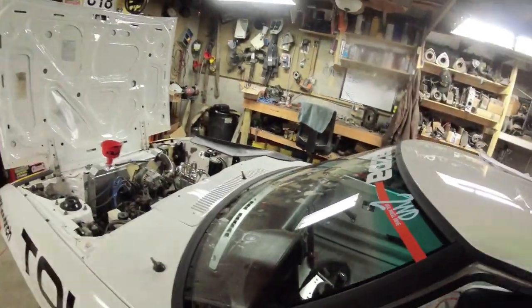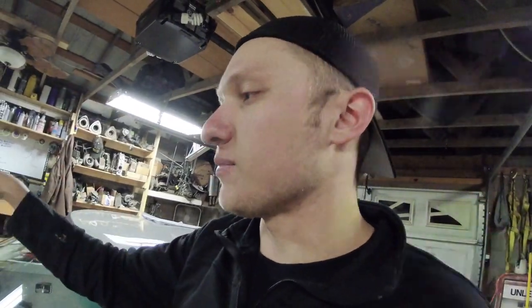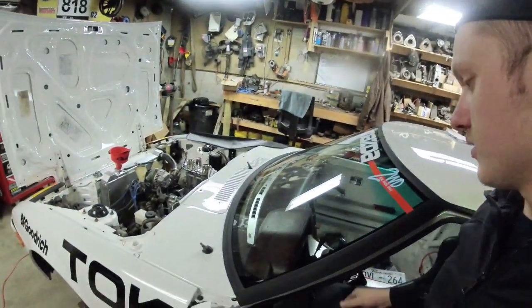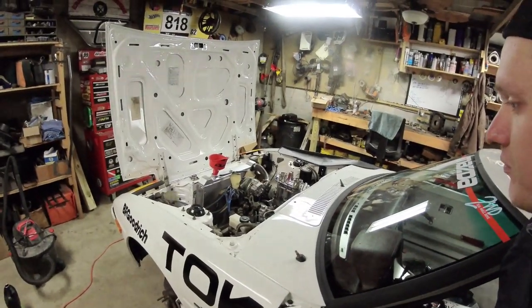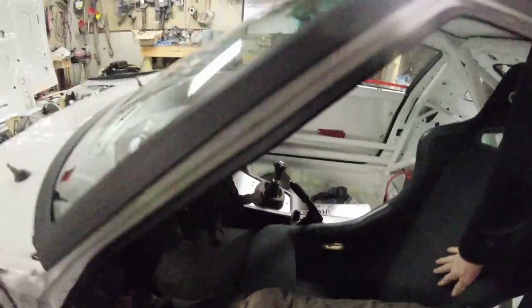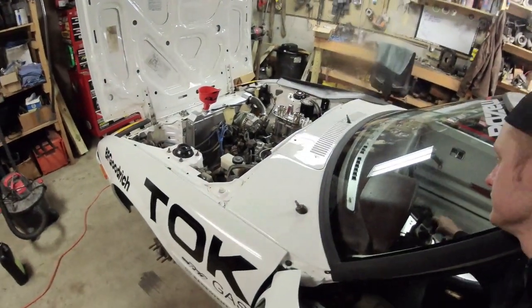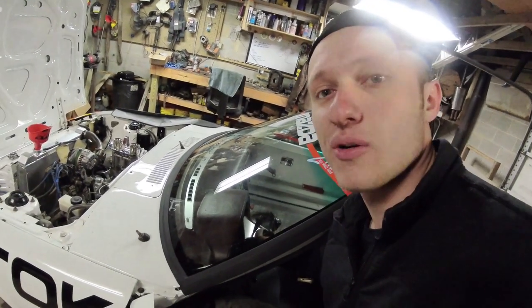This is the moment we've all been waiting for — trying to start the rally car with its fresh Weber 48 IDA. Currently I don't have the fuel pump hooked up, so we're just going to see if it lights off on what's primed, then hook the pump up and warm it up to bleed the coolant. I've removed one of the coolant crossovers connected to the upper intake manifold and blocked both ports — running true old-school 13B without the thermal wax. Throttle cable is hooked up. I'll just ground this little wire and you can hear the pump running.